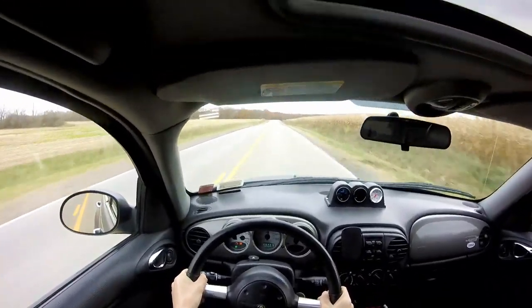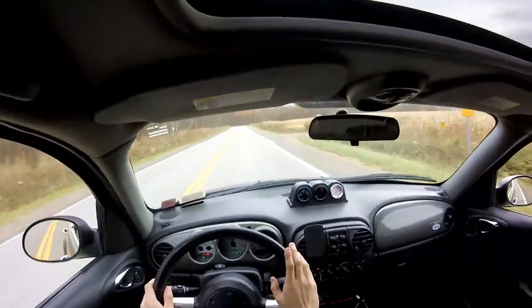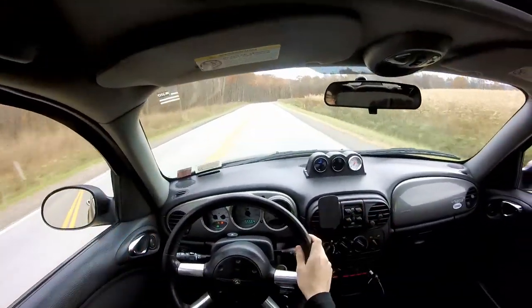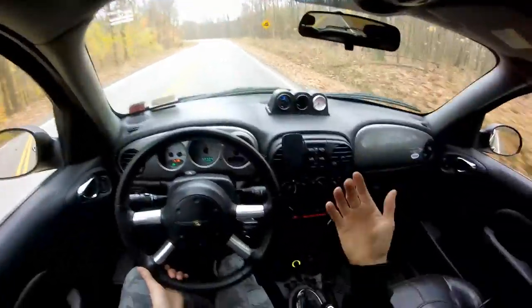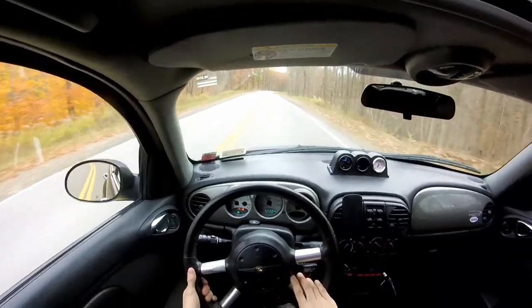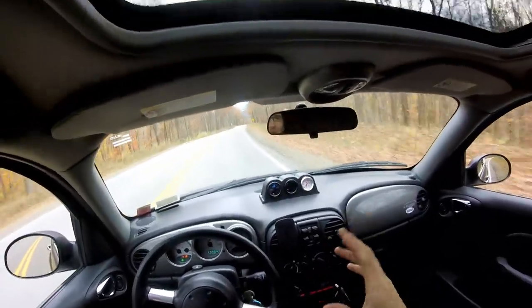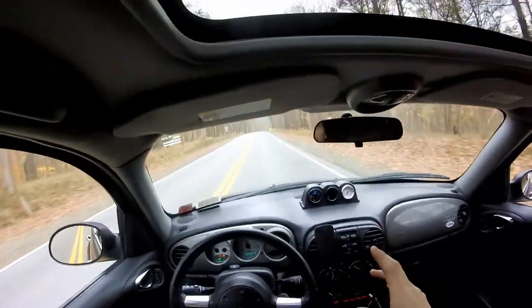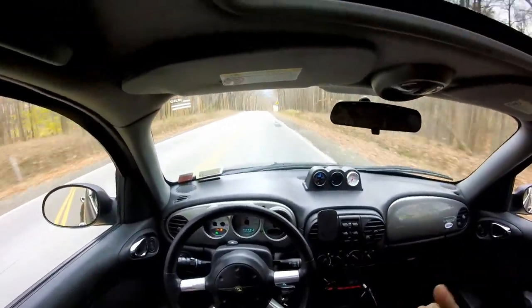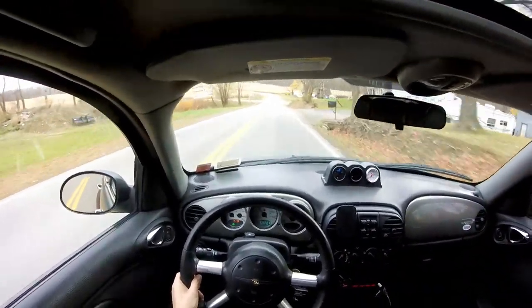It's so fast. Oh my God. Biggest thing that I noticed, I think I mentioned this earlier on in the video, I can't remember. Normally this car between gears, when you're in auto stick mode, it would shift automatically at about 5,900 to 6,000 RPMs. And it would make that almost DSG sounding kind of fart noise in between gears. You guys know what I'm talking about. I'll see if I can find a clip of it to play right now. It doesn't do that at all now, it just bangs into the next gear, which is crazy sounding.